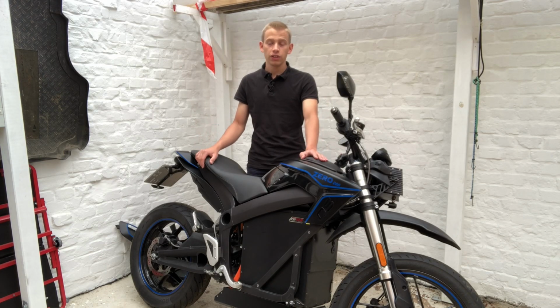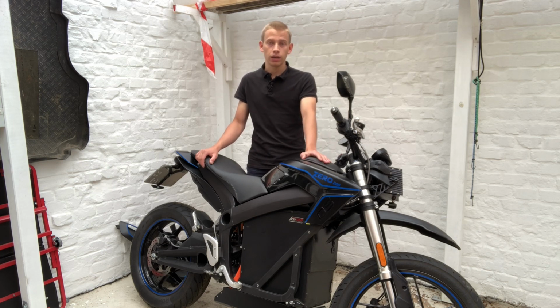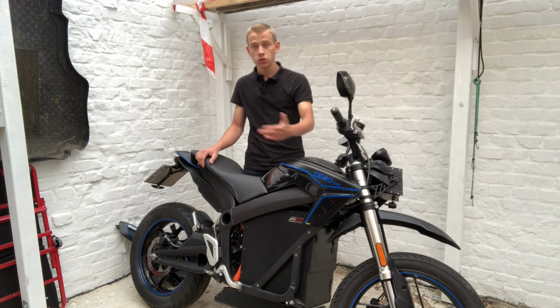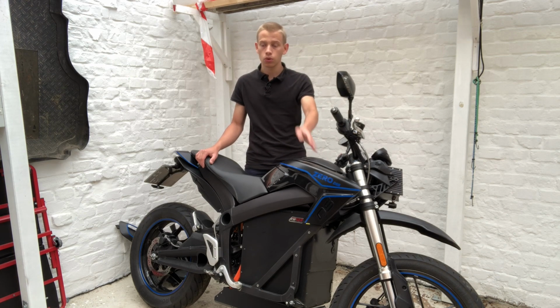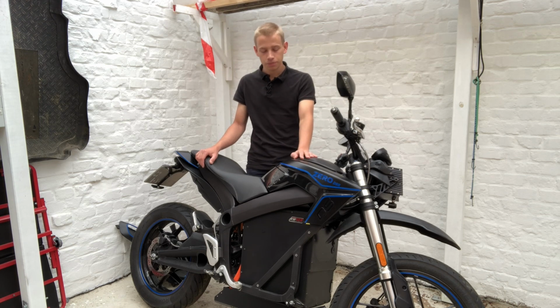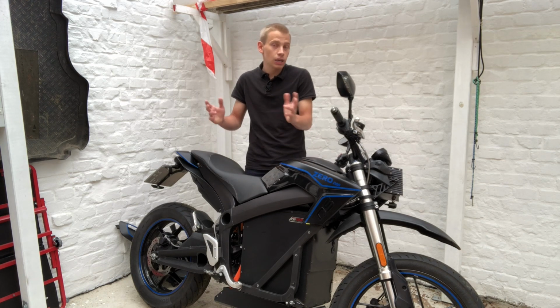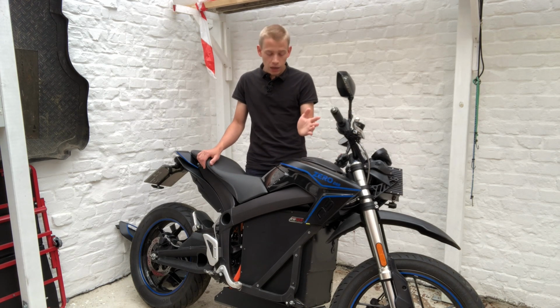And that's pretty much everything that is there to tell about my quick charging setup. The next time we will see each other again is when I go for the real test, the charging test, where I will gradually go from a few kilowatts, let's say 1.2 or 2 kilowatts, up to the expected 10 kilowatts, 9.9 kilowatts. And we will look at the motorcycle and each electrical connection with an infrared camera to see if something gets too hot. But I expect nothing to get too hot, but we will see.